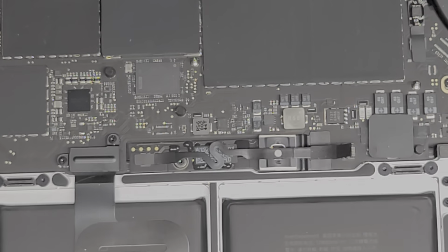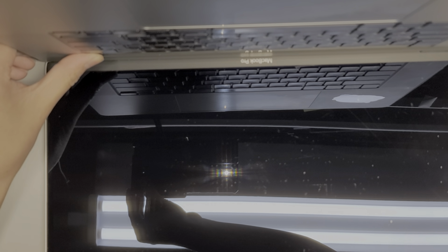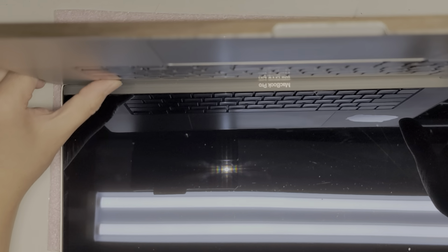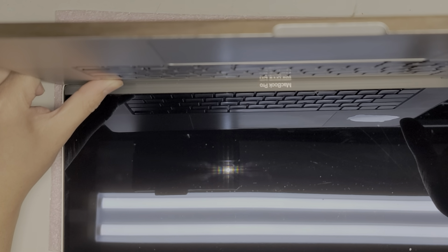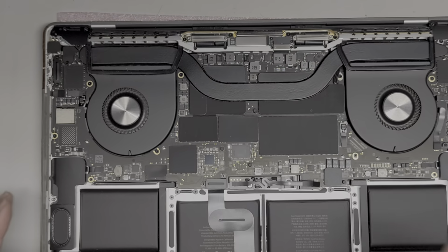After you do that, you want to open up the computer. Alright, and then you want to press and hold the power button. Oh, let me turn off my charger before I fry my phone. Okay, then you want to press and hold the power button for about 15 seconds or so. This MacBook, the customer spilled some coffee or something in it, so the button's being a little weird. So I'm going to take it out and try and clean the clicking mechanism. Alright, so yeah, just hold the power button for about 10-15 seconds just to drain any power from inside here.